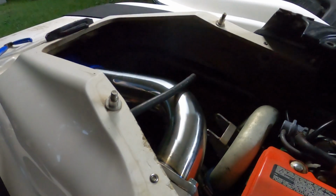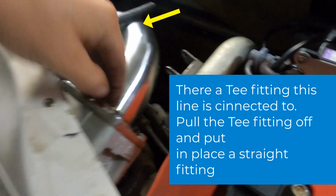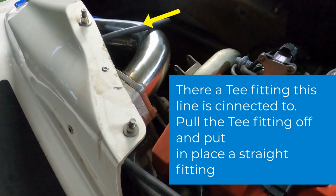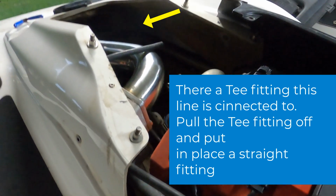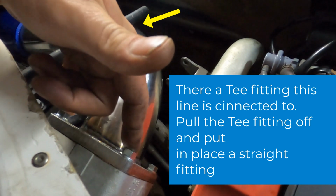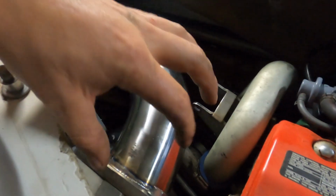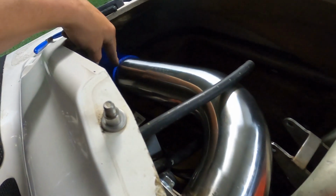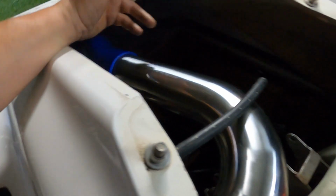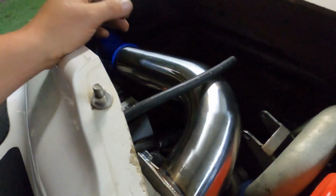Okay, a rundown so far. Copper seal the gasket, or the instructions say the RTV silicone it. With the high temp one, we just went with the copper sealant. These bolts are going to be torqued down to 20 foot-pounds, but before you put the pipe on, put this couple on and spray the inside of it and the exhaust with WD-40. I say it wrong, because it's going to be hell.